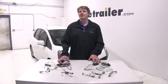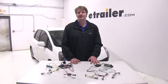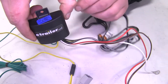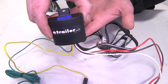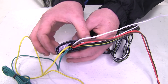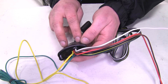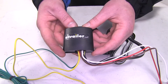The main differences between these two harnesses are the shape of the control box and their power output. The Tekonsha's control box is going to have all the wiring coming out of the bottom. This is great because it can be mounted in a way that water can't pool on the bottom to enter inside the box. This control box also has a potting material that goes all the way throughout the box to keep your wiring secure and connected to the circuit board and keep any moisture from entering inside causing corrosion, which gives it a little bit more robust and durable lifetime.